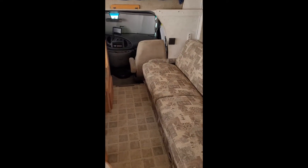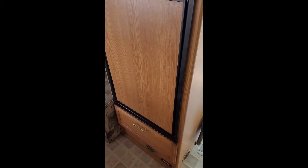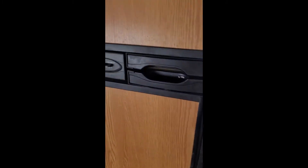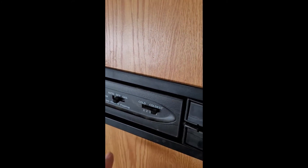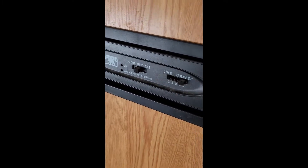Okay guys, I wanted to give you a little update on our fridge issue. This is an N611, 6 cubic foot fridge in my RV — pretty common for this size. Basically, it started doing the 5 flashing thing when I would turn it on, either on electric — it's got AC, doesn't have DC, just AC or gas. It would flash five times and the fridge wouldn't cool down. The freezer would start cooling down, but it pretty much didn't cool down.